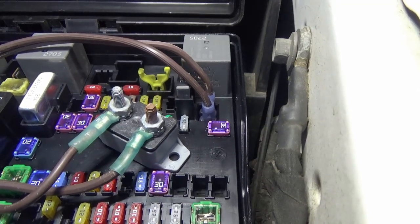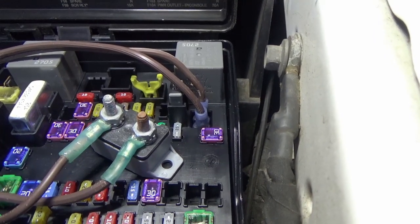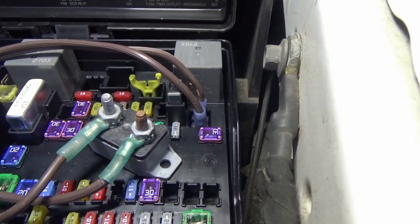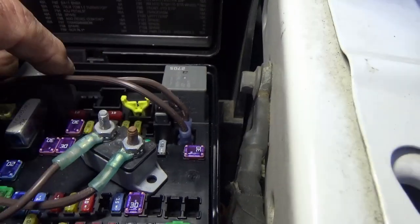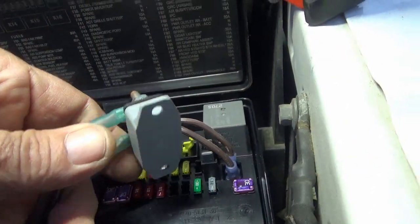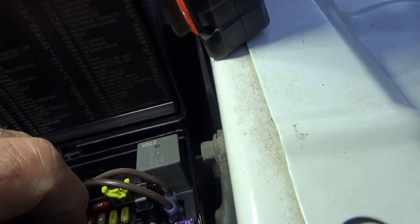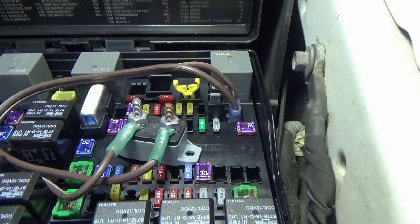It's my understanding that this system is supposed to be charged with nitrogen to avoid moisture. This problem occurred when it was below freezing last night, and I had a similar issue last year that kind of corrected itself at similar temperatures. I didn't have another fuse — I think it's a 40-amp green fuse — so I took a breaker I had lying around, wired it up, and connected it where the fuse goes so I could supply power and test the system.